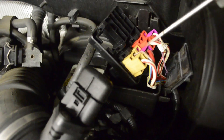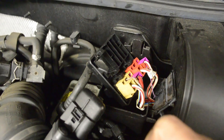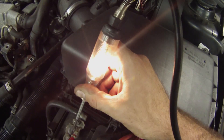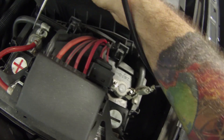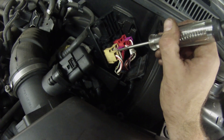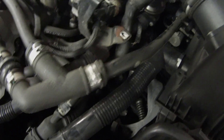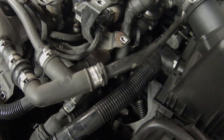Very simple — you just need to know how this relay works and what wires go to where. I have my test light connected to battery negative, or ground. Test light lights. To give this relay a ground, which is what it needs to energize, I'm just going to put my test light on the ground side and you can hear the air pump come on.